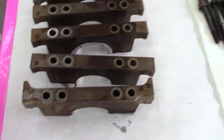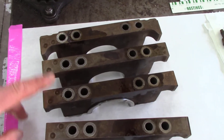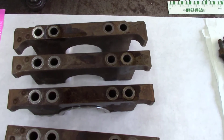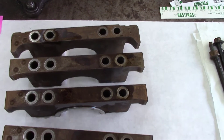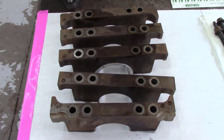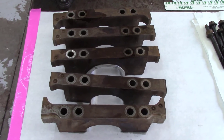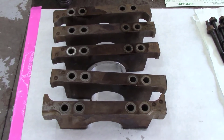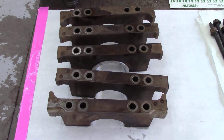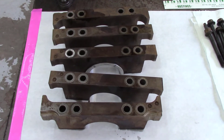Results are in: 0.0015, 0.0015, 0.001, 0.0015, and 0.0015. The range is 0.0008 to 0.0025, so we're well within spec on the plastigage. If I got a weird measurement I would use my micrometer and double-check everything — especially if you're swapping cranks and bearings — but with stock crank and bearings, plastigage is definitely accurate enough for what we're doing here.